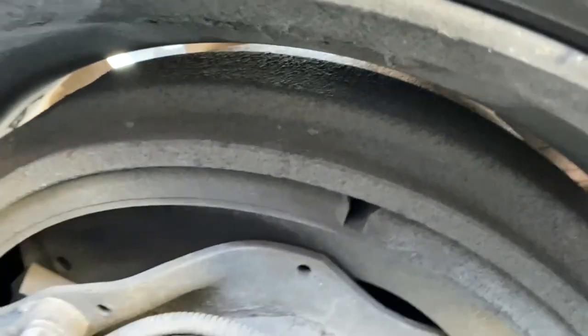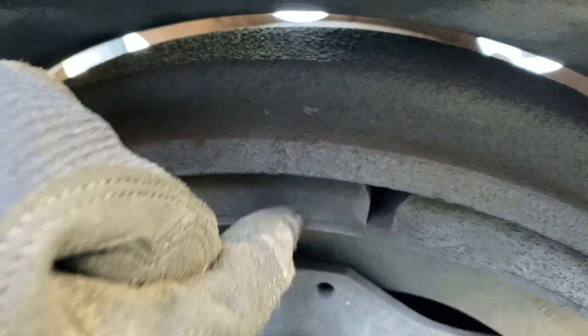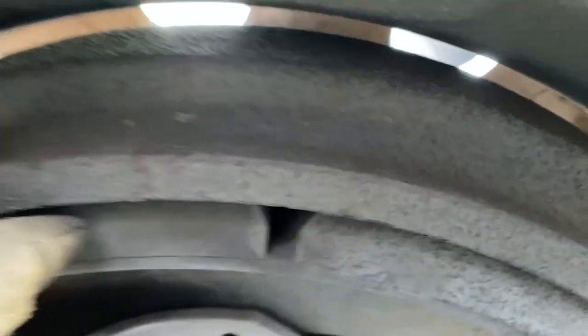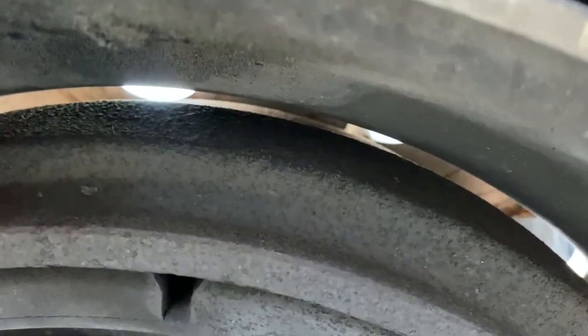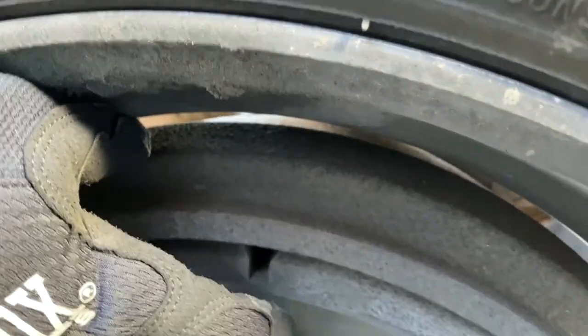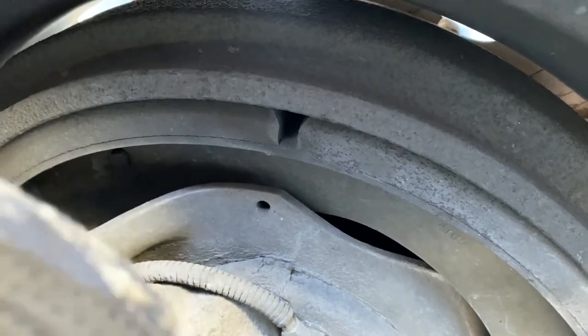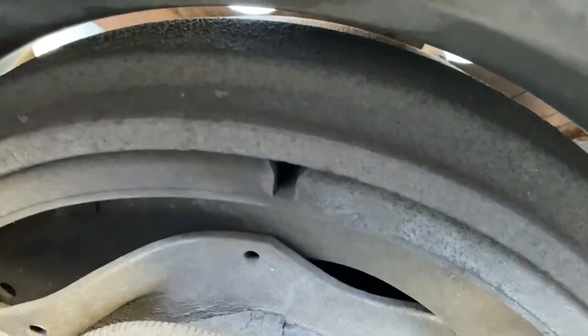Then you move on to the inside of the tire and talk about the brake linings — the linings are right here. If this is a drum system, which this is, the linings are not thin, not cracked, no visible leaking on the linings. Then immediately to the outside which is the drum area — the drum has no cracks, bends, and there's no visible leaking on the drum either. If it's a disc brake system you'd want to talk about the disc, the rotor, and the actual pads, but in this case it's a drum system.